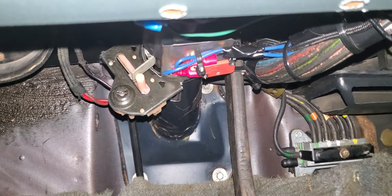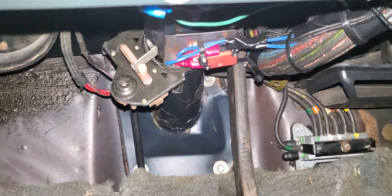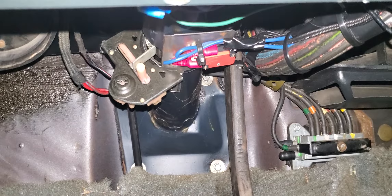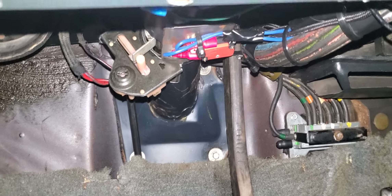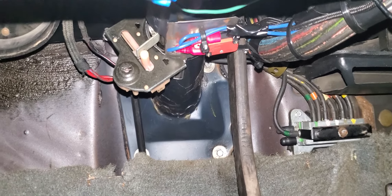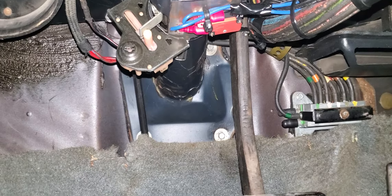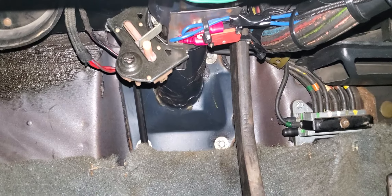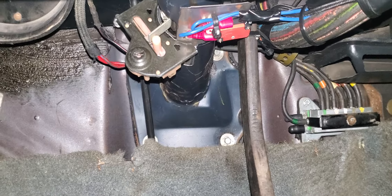The thing that's nice with that too — you guys with 61-64s will probably realize as well — is that when you first are touching the brakes, your brake lights don't come on. You actually have to start pushing and applying pressure to get that brake light switch to come on, which is kind of annoying because when I'm just starting to slow down a little bit, just regular driving, I like to just touch my brake pedal to turn my brake lights on before I start decelerating, especially when I have other old cars behind me in a cruise.